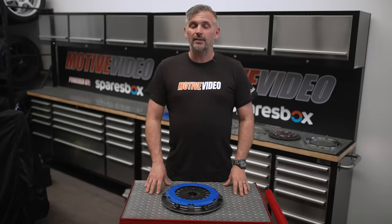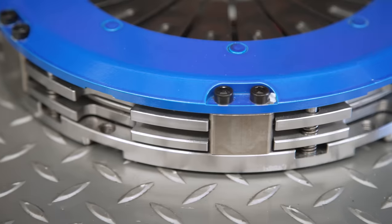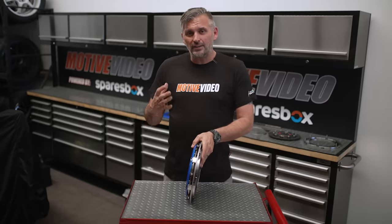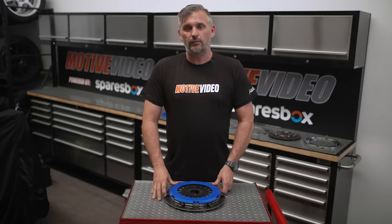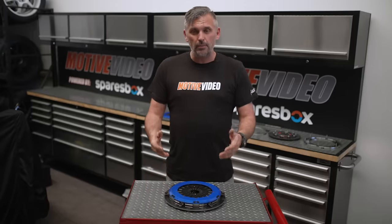One thing about twin-plate clutches is that they are noisy. That noise comes about when you put your foot on the clutch — the clutch plates and intermediate plates separate away from each other and can vibrate and rattle, essentially metal on metal. The way Uni-Clutch solves that is by putting springs on the dowels. As it separates, the spring stops them from having contact with each other or dampens that vibration — so they can still move, but they can't touch each other anymore — which gets rid of that twin-plate sound so that you can get OE levels of noise and vibration. The Uni-Clutch comes pre-assembled, so you don't get to see all the cool stuff inside when you put it in your car, but we're going to open one up and show you.